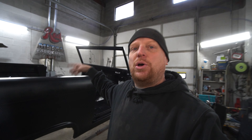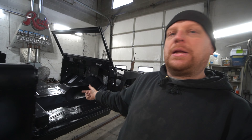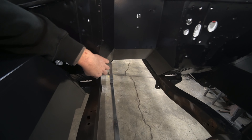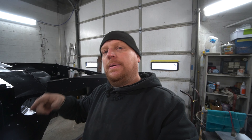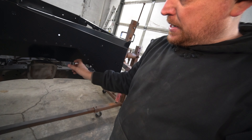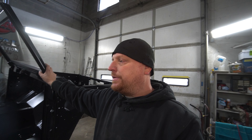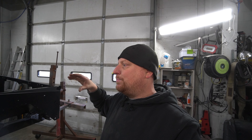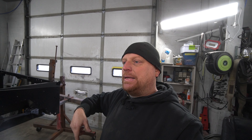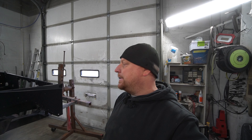Got this thing epoxied over the weekend and rolled back over here on my side. We're going to back-tape it so we can undercoat the bottom of the floor pan up to about this line here. From that point down, all the way through the back, will all be bed-lined. We're also going to try to shoot this outside area underneath. It's been sitting - today would be 24 to 48 hours, so we have a 72-hour window to top coat. It's been pretty cool out so that's slowed down the cure process a little bit, so we should have plenty of time to get this bed-lined. For that we're going to use the Raptor kits - I've got about six quarts, should be enough. I'm going to get this thing taped up and get ready to bed-line sometime today.